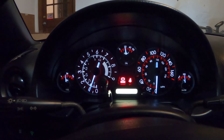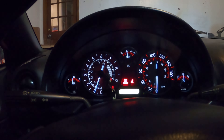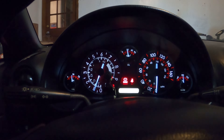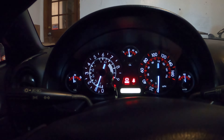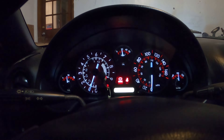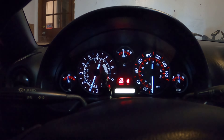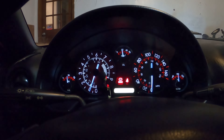Right as I was about to put everything together, I noticed that my high beam indicator as well as my check engine light no longer work — those are the ones I relocated using an honestly pain-in-the-ass wiring harness trick in the back. I decided screw it for now, at least for the check engine light, because I'm about to go with a Megasquirt anyway. Also, because I did an EGR delete, the check engine light was already on all the time, which basically gives me no useful information. So I said screw it, I'm just gonna drive it and enjoy the CEL not being on. Here pretty shortly — especially if we're doing social isolation for more weeks — I will fix the high beam indicator. That's probably a decent idea.